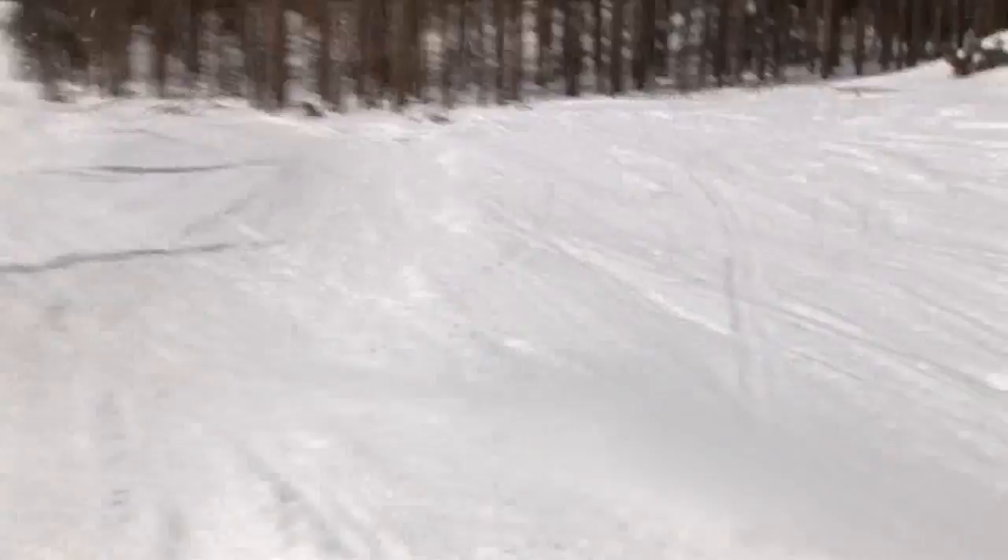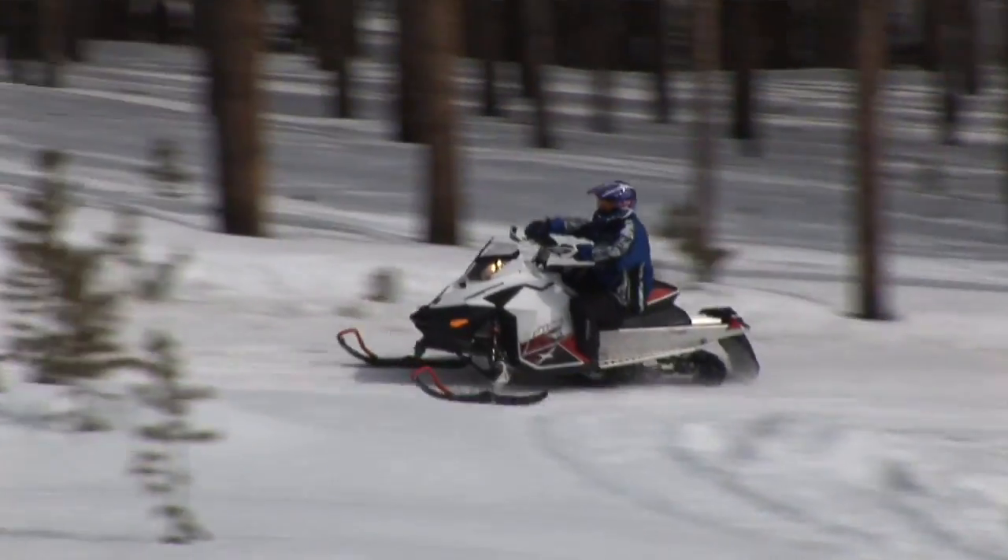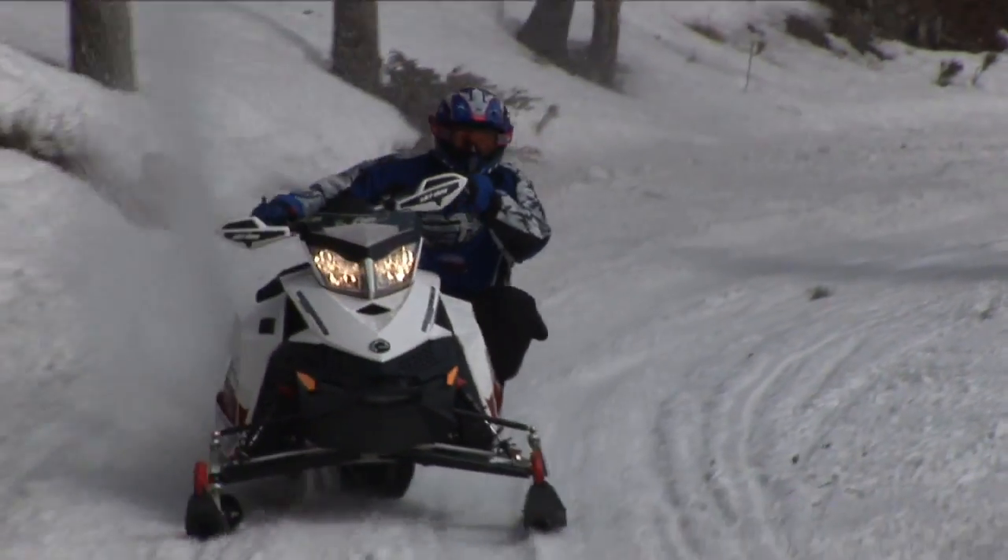There are a lot of changes in the front suspension. What I really like is the recalibrated front suspension. They've got the KYB shocks up front with external adjustability. They have a stiffer spring rate, which helps reduce diving in the front end when you're letting off the throttle. This thing really goes into the corner well this year.